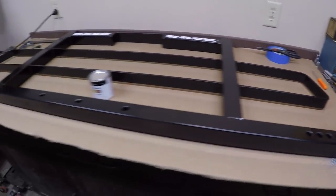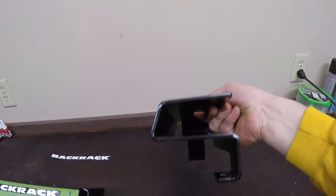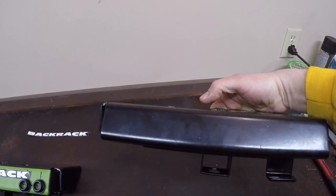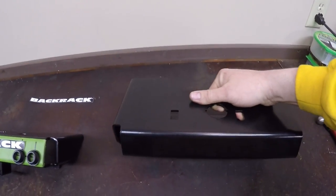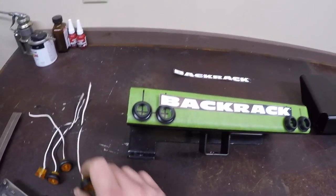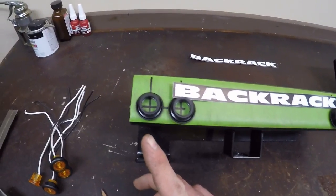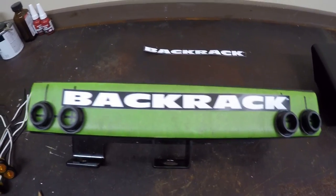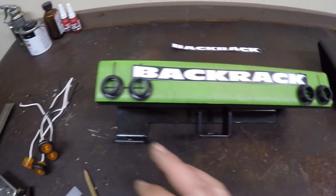Now to talk about those other lights — I've got these two riser brackets that lift the back rack two inches for it to clear the tonneau cover. They have these nice flat surfaces that face out and tip inward just a little bit at the top. Any nice flat surface area that faces out is good for more lights, so I'm gonna do some more of these round amber lights on these brackets. I got these spaced one and one-quarter inches apart, kind of low toward the bottom, so that I can still utilize these Back Rack stickers they sent me.